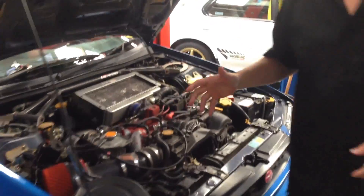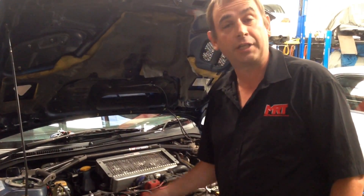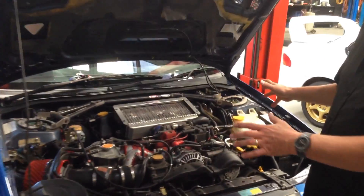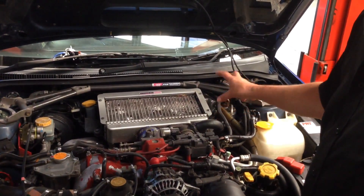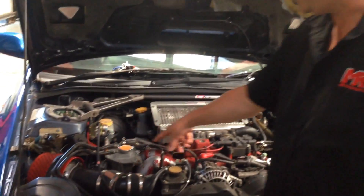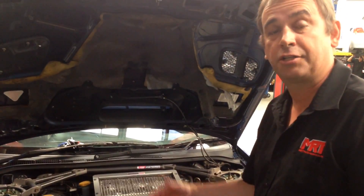This has been custom tuned with our software. A lot of people think that you can't custom tune the factory ECU in the 99 to 2000 model Subarus — you actually can in the turbo model. So this has been custom tuned to the upgraded engine. It's got the original upgraded Subaru STI intercooler. You can tell the model that can be tuned with the factory ECU by the bolt-on blow-off valve which has got a flange connection to the intercooler. It's also got a modified air intake because this car has increased capacity and requires more airflow, which the factory standard airbox in this configuration restricts.